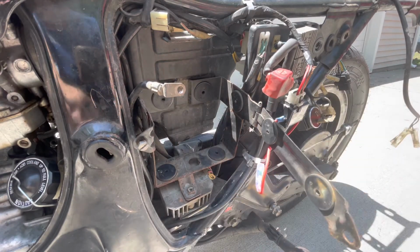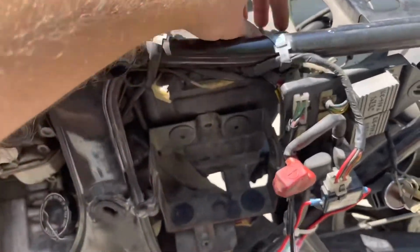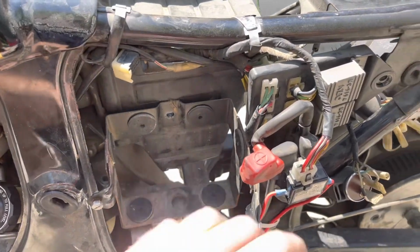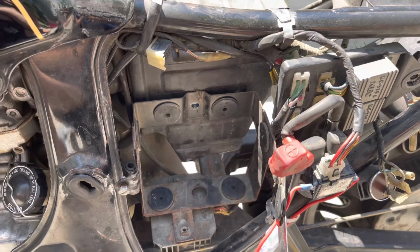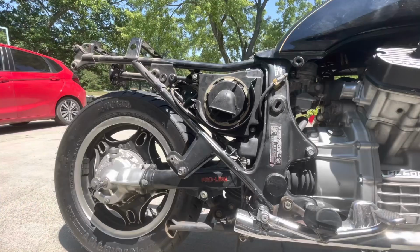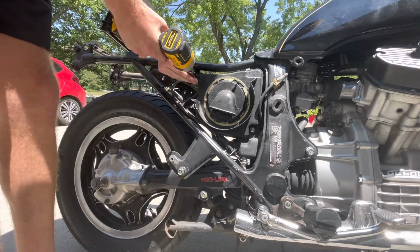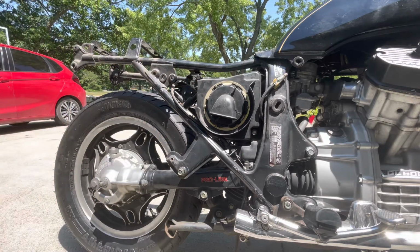All right, we'll go ahead and start pulling some bolts and screws and getting this apart. I noticed also there's one more very, very sneaky bolt hidden way back here, and I think I have to come at it from the other side. So I'm gonna start working on pulling the air box and then the battery box and all this electrical stuff. I thought it would be the reverse order, but we'll figure it out. We'll pull the first pretty obvious 10 millimeter right here, and that already loosened everything up for me.